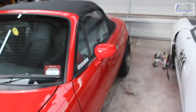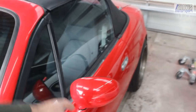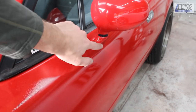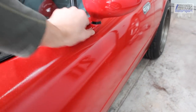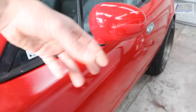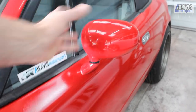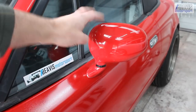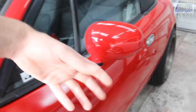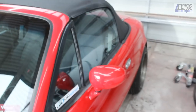While we're here, I should also talk about the door mirrors. These are known to fail, particularly on these early 1.6s with the manually adjusted mirror. There's a bolt that goes from the bottom section into the main part of the mirror. That bolt can get old and corroded over time and the mirror can get floppy or even fall off entirely. If that happens, you lift the plastic piece up, there are a couple of Phillips head screws, pull the whole piece out and the bolt can be replaced. It's a little bit tricky but it's not a disaster.